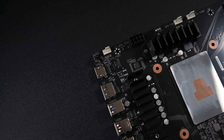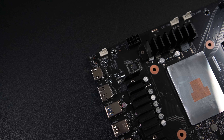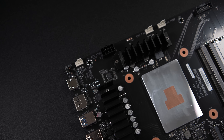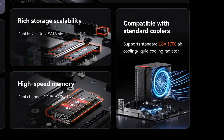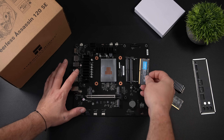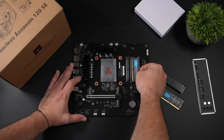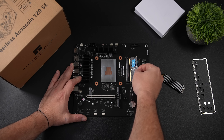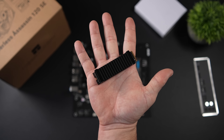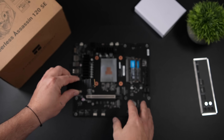Since we're working with a mobile CPU and have to add our own cooler, they did add a little copper block here. It's pretty interesting what kind of cooler you can use because this supports an LGA 1700 mount. It's a little odd because that's Intel, but it's just the way the board's laid out, and there are tons of LGA 1700 coolers on the market. You can go liquid or air-cooled. I'm adding 32 gigs of RAM — this is 5600, but it will only run at 5200. I've also got a 2TB M.2 PCIe 4.0 SSD going into the top slot.